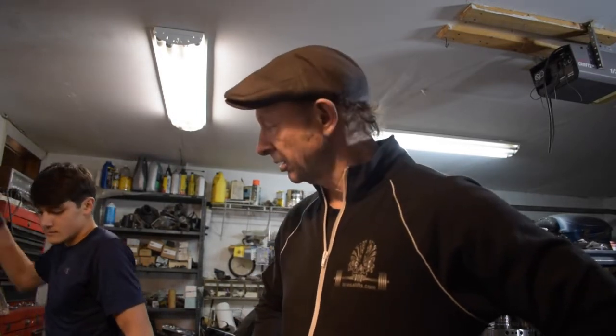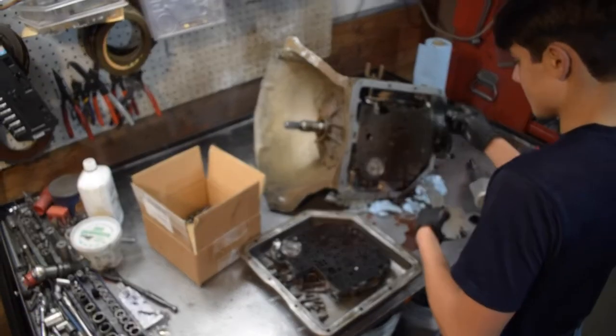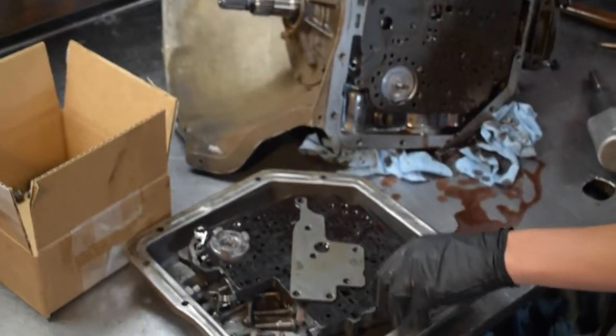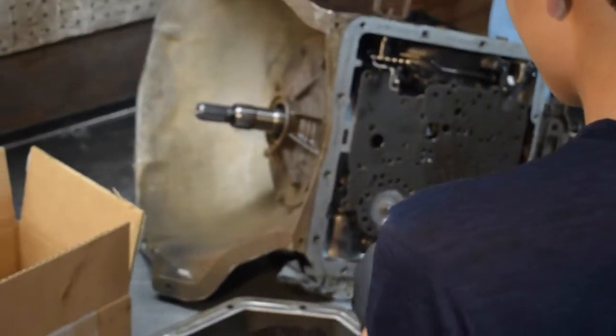Adding more clutches displaces more energy - that's the whole point of having more than one clutch. We'll increase the line pressure and do the dual feed, so there's more volume of fluid behind that piston - that's usually for the direct drum. We'll go through all that. Joe just took off the valve body and he'll go ahead and take off the pump.